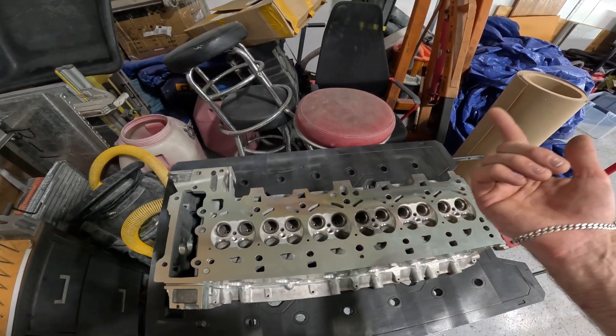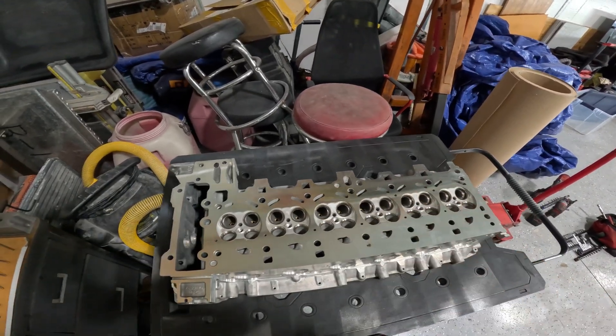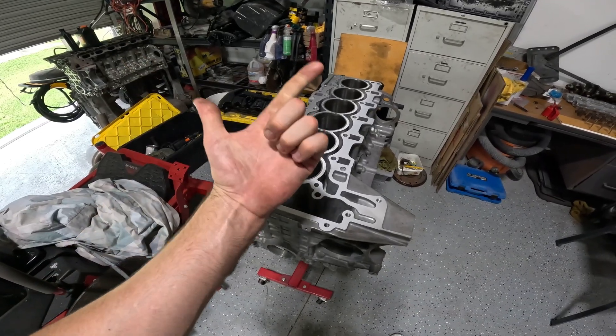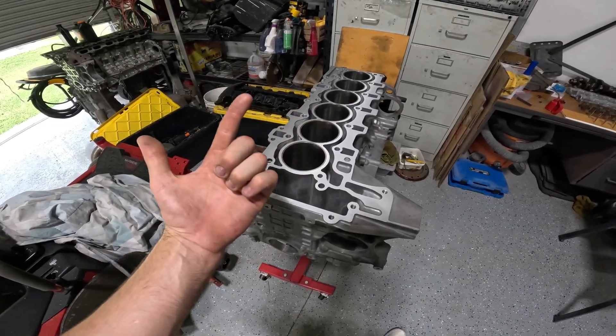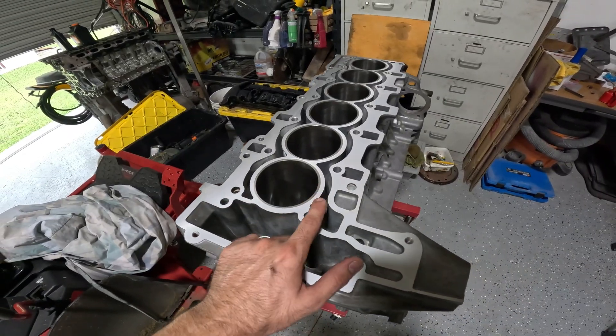I did this with my old built motor and it worked very well — no valve leak, everything was perfect, compression numbers were good, leak down numbers were good, the cylinder head did great. Plans for the block: forged pistons, forged rods, 11 millimeter head studs all the way around, and I will also be doing an epoxy closed deck. I know a lot of people say it's going to fail over time, but Honda guys have been doing it forever. It works. It's not your aluminum insert closed deck, which is the real way to go, but it'll do.